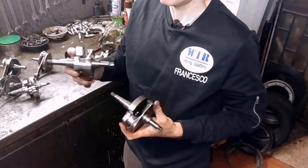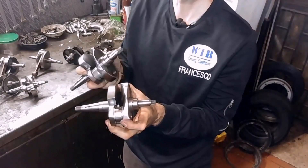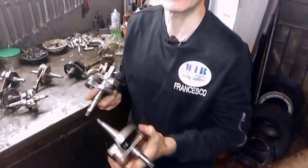Among other things, these shafts have a not exaggerated interface. The shoulders have about 1 cm more than the limit represented by the Mazzucchelli cut, which can be advantageously removed if you want to squeeze the engine more, also benefiting from the sweet shape of the shoulder profile. Another very important consideration: the advantage of having a more voluminous crankcase and therefore a more worked shoulder is that it allows, without regurgitation, the exploitation of the advantages of a long intake phase with a significant delay. If the crankcase is too full and the phase is too easy to delay, it will be easier to have low-revs regurgitation.